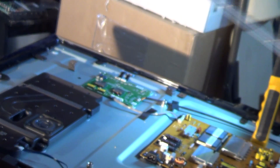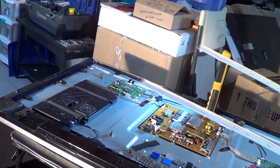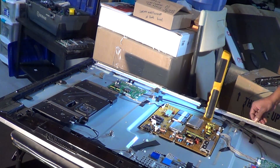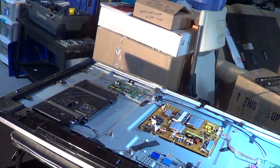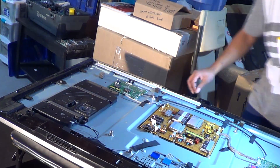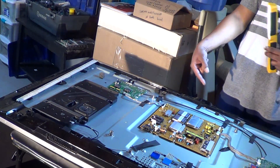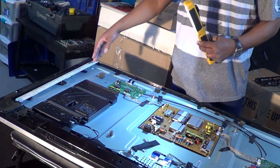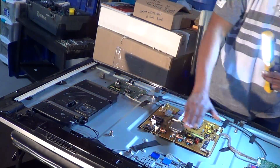What they use is a big diffuser screen. The way these are mostly set up is you'll have two strips in most cases, and they'll be located at the top like this, right next to each other, or they'll be located one on each side — one on this side of the TV and the other one on this side. The LEDs will be facing toward each other. There's a big diffuser screen, which goes across up to the height of the LEDs, and that's what spreads the light evenly across when the LEDs light up.